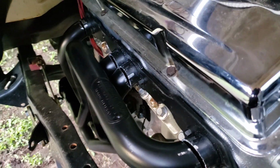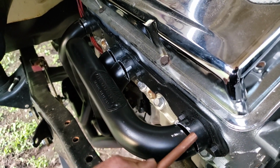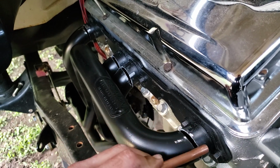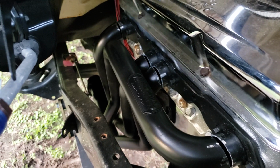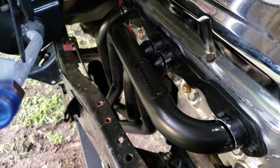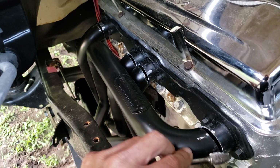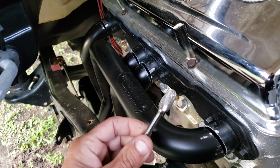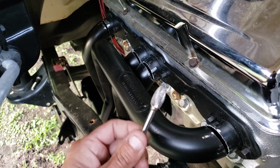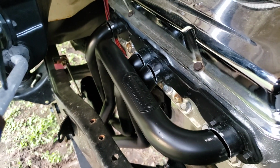But filling in the gap, I'll just take a copper tube, stick it in there, MIG weld, go all the way around, just so I don't have a big slop of stuff that I gotta fix on the inside. Then I will take my porting bit and I'll port the inside of the tube, smooth it out, get rid of all the welding. The porting bits blast through steel really easy. So $25 from Eastwood, well worth it.